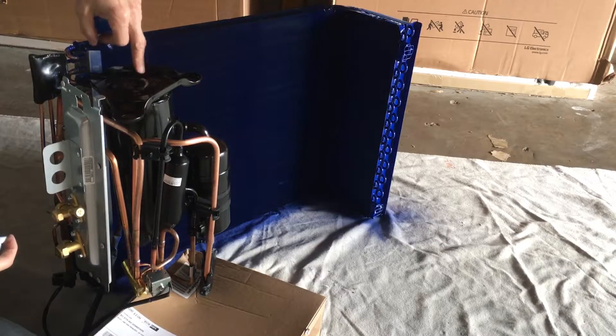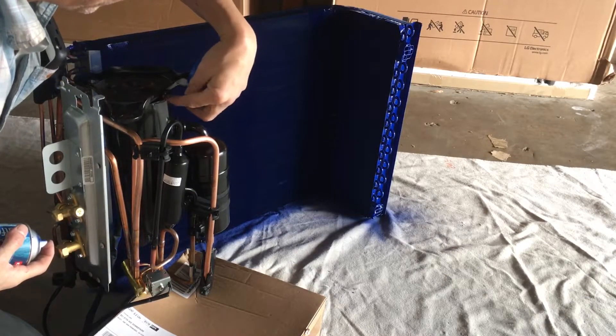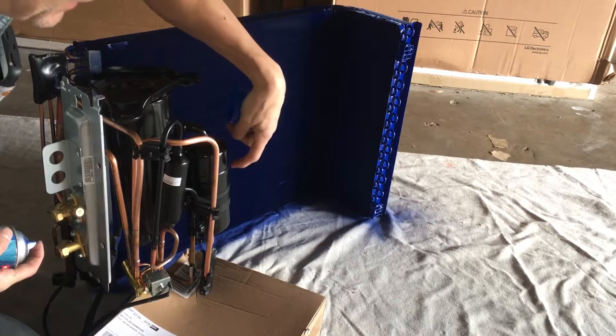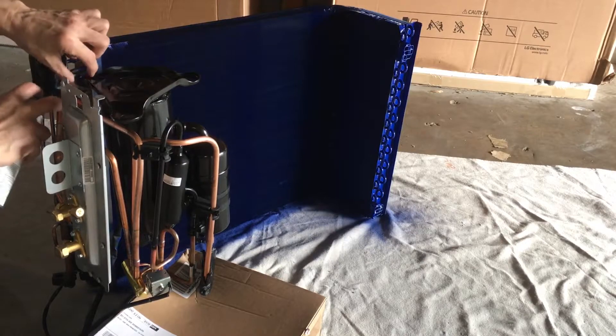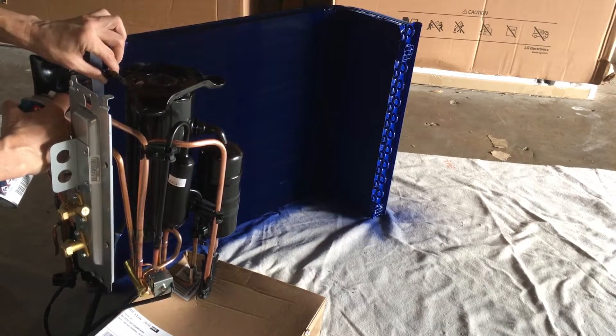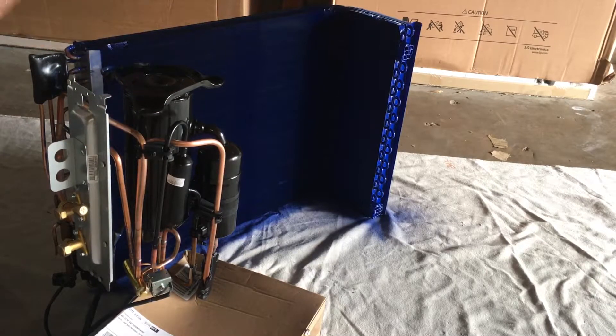Some guys asked me if we could see these applications, so I'm taking you through the boring process of painting — never thought I'd do that. Now here comes the problem because this is kind of in the way, so you just do the best you can with what you're given. Remember you don't have to get blue — they have clear so you don't see it. I'll get all these little pipes and tubes too. If you're in a really bad area you may even want to coat those pipes — you see where they weld on all these plates, the paint wears away, it rusts, and you can develop a leak in a receiver dryer, accumulator, or muffler tube. If you're right at the coast and salt water gets on this, you may want to spray that too.